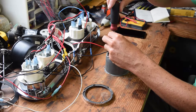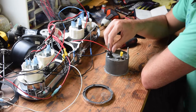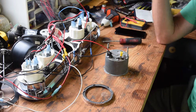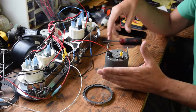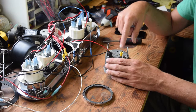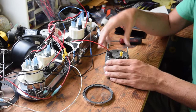This is a four cylinder tach, which means, if I remember correctly from everything I've read, it reads the pulse from the engine every 12 milliseconds or about every other stroke. So what I've done is converted this so that it reads double the pulses. You have double the cylinders, so it needs to read more frequently.